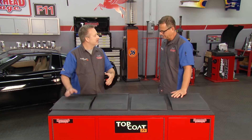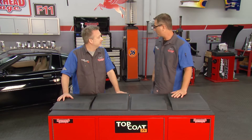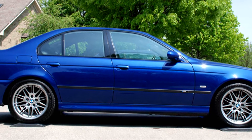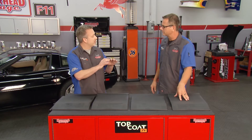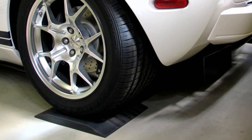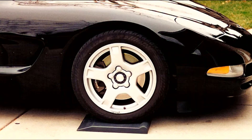It's not just for situations like mine. If you have a sporty fun car like this, chances are it's not your daily driver — you take it out on weekends, or if you live up north you can only drive it in the summer, so it'll sit all winter with flat spots. For newer cars think about those 18-, 19-, 20-, even 24-inch rims — a bigger rim means a smaller and smaller sidewall and wider tires. With smaller sidewalls the tires deflect less, so that deformation transfers to the tread instead of the sidewall. Wider tires also pick up more temperature from the pavement, making them go flat easier. And the softer compound on performance cars makes them grippier and more fun, but also more susceptible to flat spots.